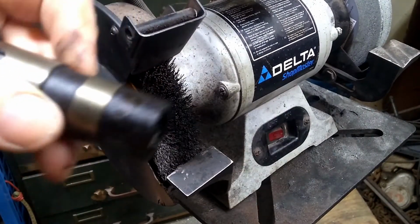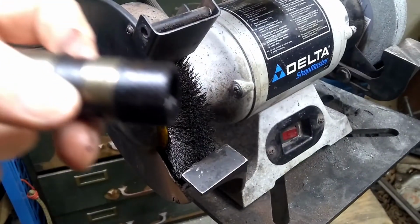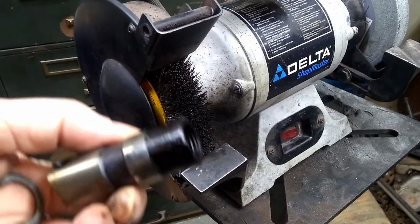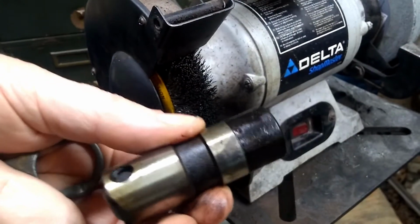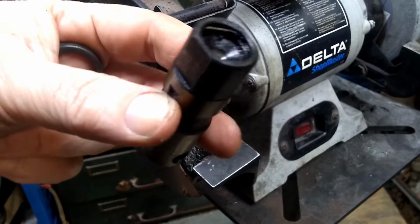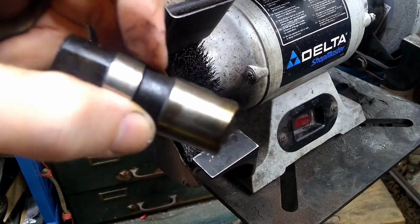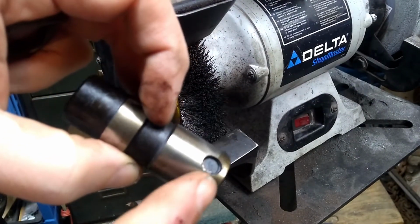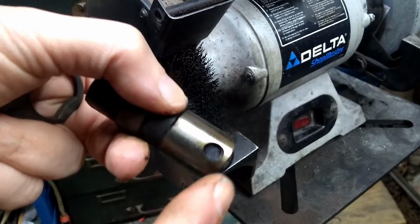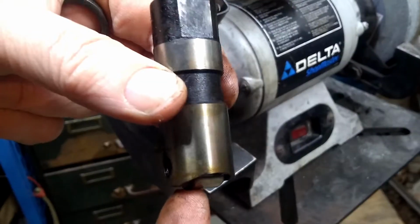And we're going to inspect all the lifters as we clean them. But generally speaking, if you checked the camshaft and it was good, then the lifters are all probably good too, because if a lifter goes bad, it takes the camshaft out with it. When I took this motor apart, some of these lifters didn't come out super easy. What happens over time is they build up a varnish down here and then right up in here, and so they don't come up out of the bore easily.